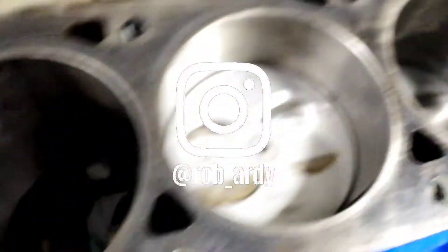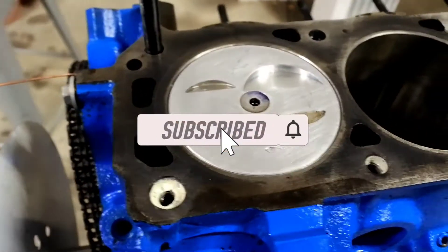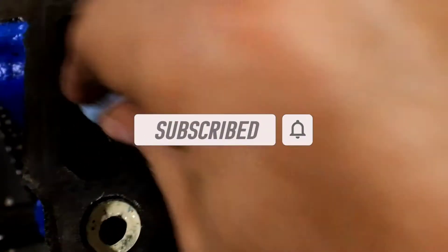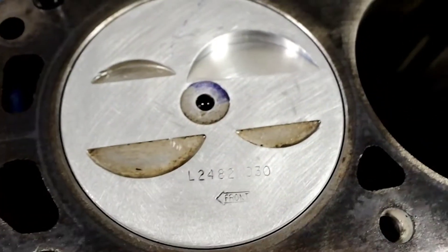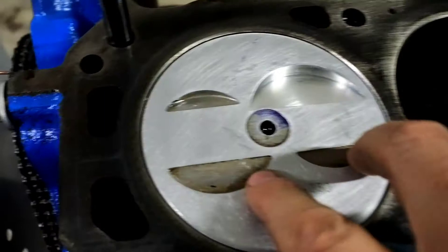Check this out. Back here, look — there's no piston in that hole, but there's a piston there and a piston there. On this piston here, you'll notice that there's valve relief. There are four valve reliefs in this piston, and it's designed so you can run this piston on either side of the block. As long as you've got front going to the front, these valve reliefs would be on top and vice versa.